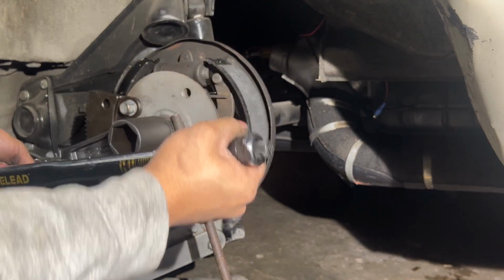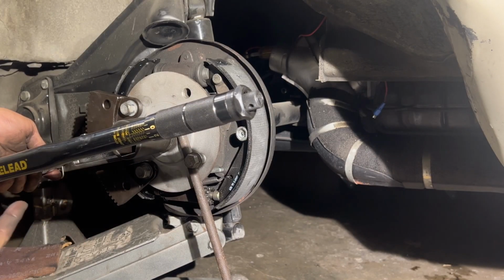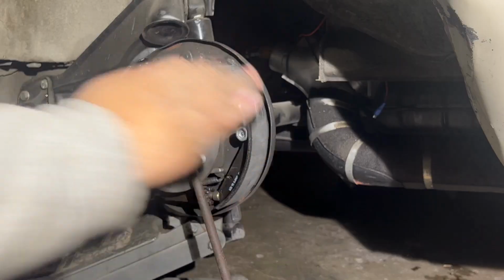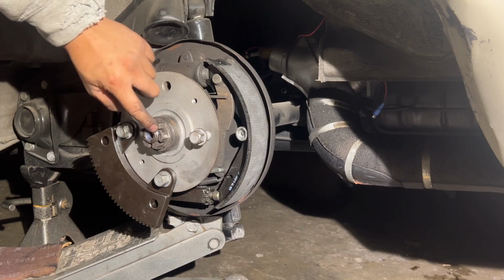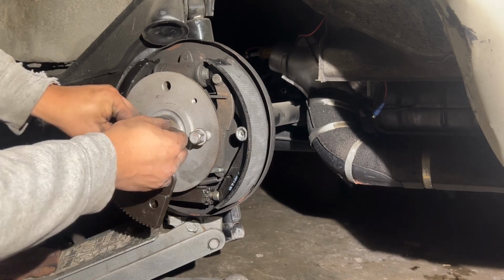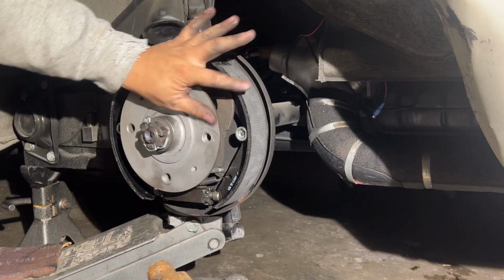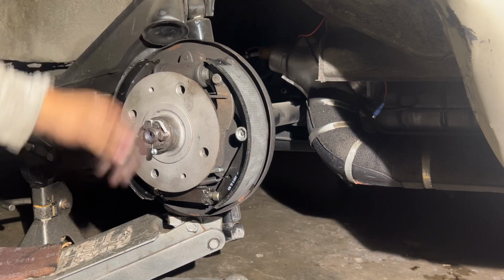That's actually super light, and I'm kind of nervous about that. I mean, it feels really light, but yeah, that's 30 foot-pounds right there. And like it says here, 30 foot-pounds equates to 270 foot-pounds on this axle nut. That better stay there. This can come off just like that. And fortunately, that hole lines up with the castle nut perfectly, so this can go in just like that. Okay, perfect. All right, now nobody can say that I didn't tighten this tight enough, because it's literally torqued to spec.